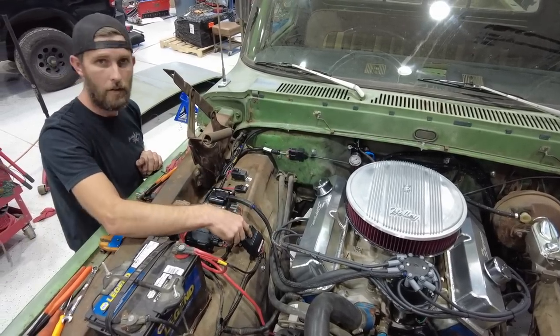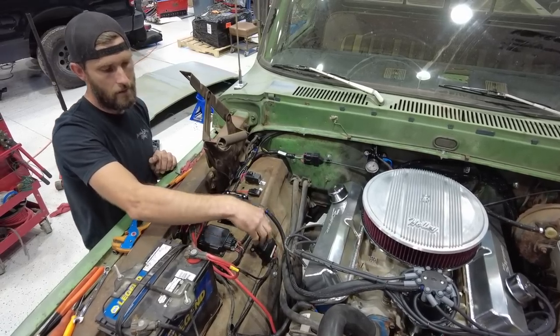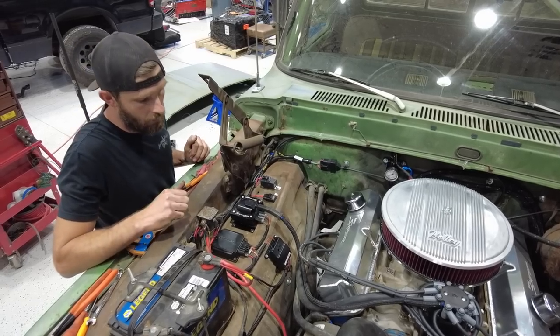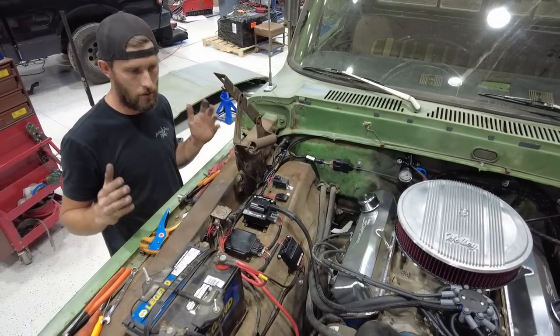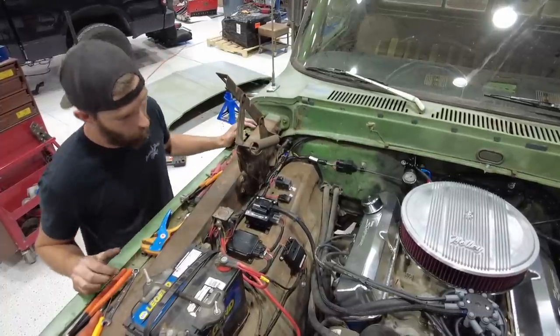Remember, when you're wiring up one of these relays, that they have a bus bar that ties the power inlet to the two powers. It's designed out of the box to be a ground side trigger. We removed that. We're using a key on trigger. So just look through the instructions. There's quite a bit to take in. Make sure you read the instructions several times, because you're dealing with spark and fuel and high pressure fuel. You don't want to have a fire or get electrocuted or both.